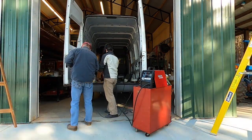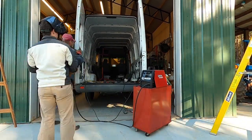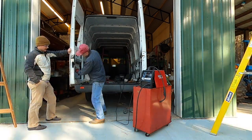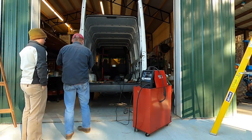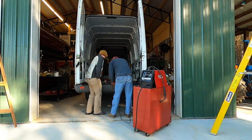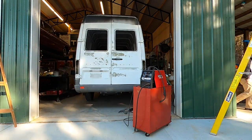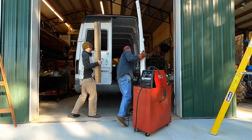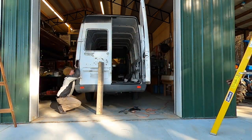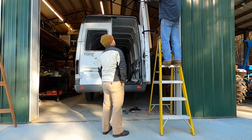It really took a lot of time to weld in all the panels. At the same time we were pushing the concave dent back out — a push and shove of trying to get it lined up, sometimes pushing too far and having to push it back. Every time you weld you heat up the door, which can cause it to flex and warp, so it was a struggle to get everything lined up and make sure the door still shut. Once the doors were reinforced from the inside out, we found that one door was slightly more concave than the other — the passenger side door was too far concave.